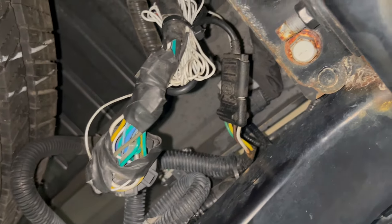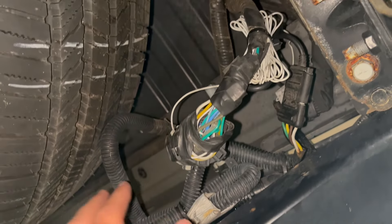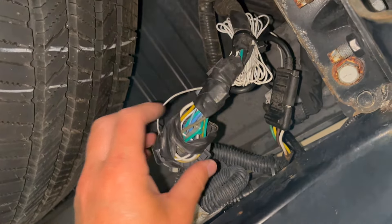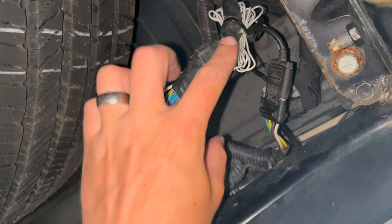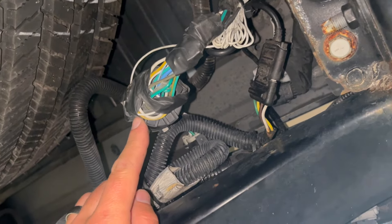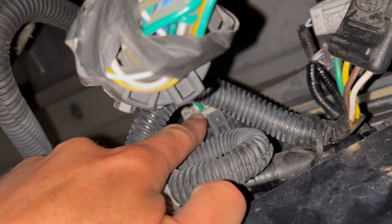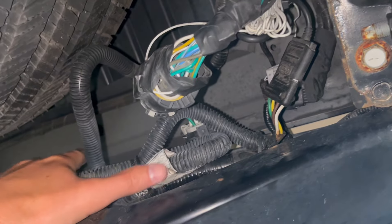The first thing you want to do is disconnect the three wiring harnesses. I have a light bar on my bumper so yours probably won't look like this — this is an added adapter to make the light bar work. So typically this connector goes in right here, and you'd want to disconnect it from here. But I'll be disconnecting it from a different point because the harness is going to stay with the bumper.